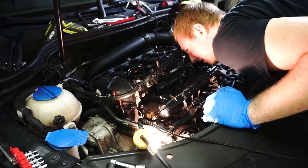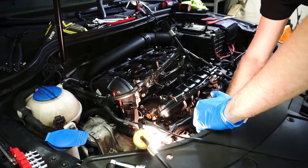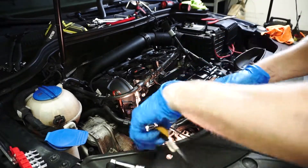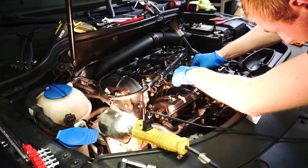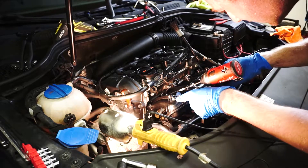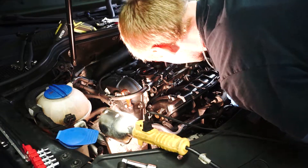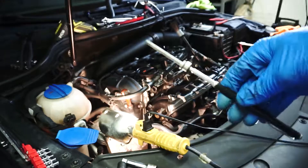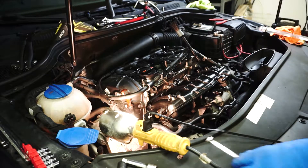Connect the sensor — looking upward, click, all good. Put all those pieces as they should be. The line is fine. Put a little bit of pressure on it — it's in. The last thing is the bracket itself. If we have support from the bottom it's good. Four bolts — two to the top and two to the bottom. Don't put a lot of tension, just snug. Throw in the bottom bolts — you can literally see them from the bottom. For the second bottom bolt use the magnet tool: simply slide it back down and we're all good.